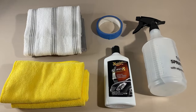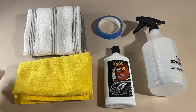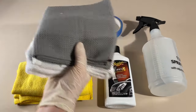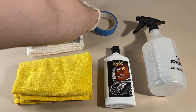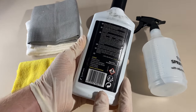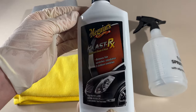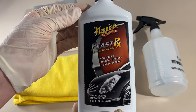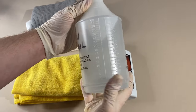Here's a list of the things that you're going to need. First up, some clean microfiber cloths — make sure these are clean, otherwise you could cause further scratching. You'll also want some clean 100% cotton cloths; I just bought some cheap 100% cotton tea towels. Again, the key thing is that they're clean. You'll want some masking tape. The key ingredient is Meguiar's plastic polish — the one I've got here is Meguiar's PlastX, but depending on where you live it might be called something different. This video is not sponsored by Meguiar's, it's just the best stuff I've found for removing scratches from plastic. Finally, you'll want some water, ideally in an accurately labelled spray bottle.